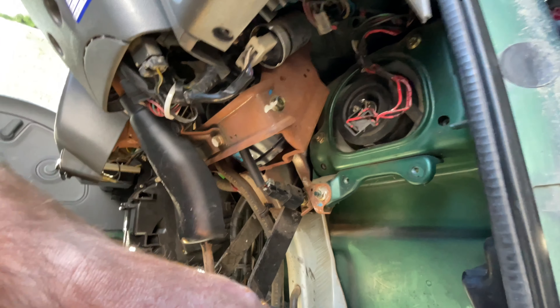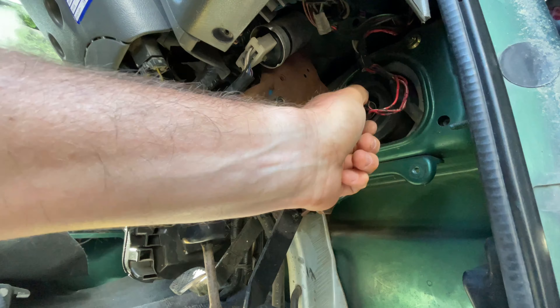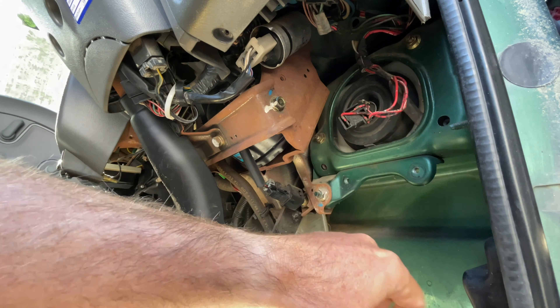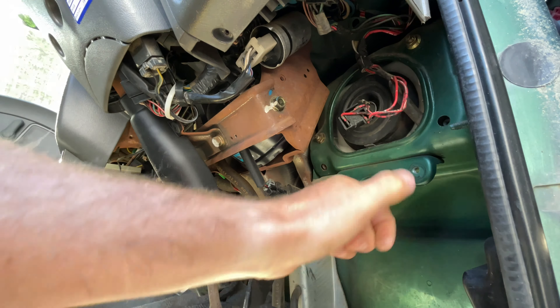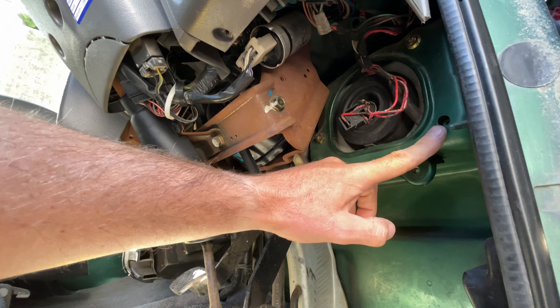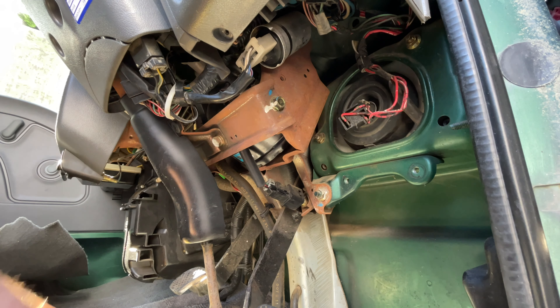I just changed the bulbs, so I was doing a little video on how to change the bulbs and showing the adjustment screws for angling your lights. There are two holes with screws here. I think the '92s and the '95s all have these holes — I'd have to double check — but it's definitely here on a '97. And that's how you angle your lights.